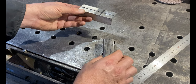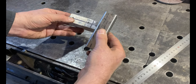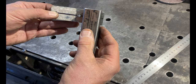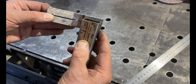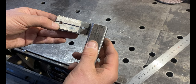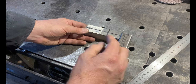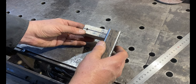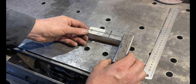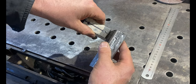This is how it's going to be orientated on our angle. The angle will sit like this, and the box needs to stick out this end — don't weld it the other way or it's going to go into your seat and it won't work. It must be welded out this way. There's enough space allowed here to bring your angle in approximately 5mm from the edges so you can get some welding. We don't need to weld underneath it — this is just supporting the handbrake. There's no downward force on this; it's just pulling the handbrake up. These handbrakes have a pretty weak spring, but it looks like you could put a stiffer spring in them, or even set them up with a load cell. As long as you get welds in the top of your box right around the top on the angle, that will be enough weld.